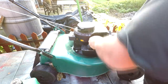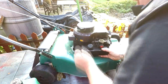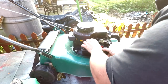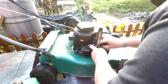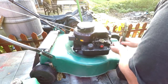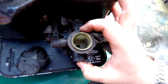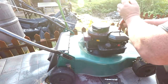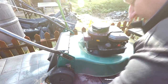That's why if you're going to repair lawnmowers or want to make a bit of money doing this, give yourself a fighting chance and pick a Briggs & Stratton classic engine lawnmower like this. These are mostly carb problems when they've been standing, and I'm sure someone else who didn't know anything about lawnmowers would probably just give up. We'll get that screw in there. I'll give it a few primes now just to push some petrol through. Make sure the linkages are working correctly. Let's try and give this a start after two years sat outside, after it was already sat outside for five years in the bushes.